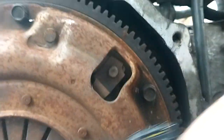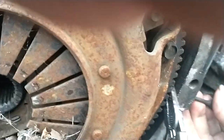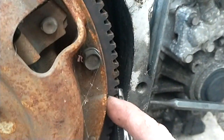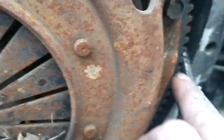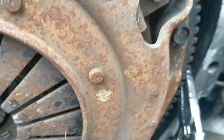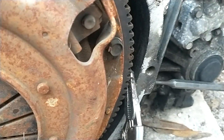I put this onto the tooth — I used the smaller diameter because it goes deeper into the ring gear teeth. I used the needle nose pliers when I was tightening and loosening the flywheel because I could lock it in place and not have to worry about it coming out. So it worked great for changing the clutch and flywheel.